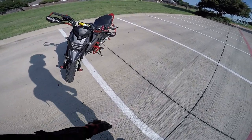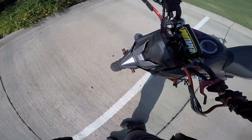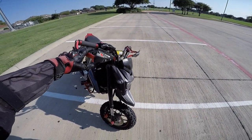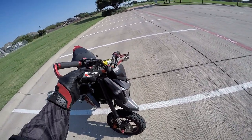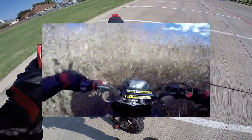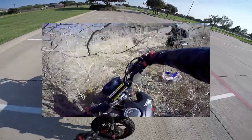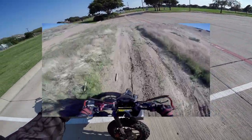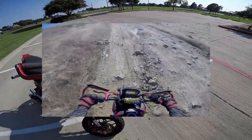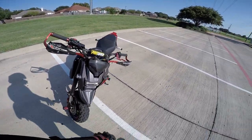Next up are probably the hand guards — these are the Zeta drop-down hand guards. I bought them as a kit on eBay for about $100, but now you have to buy the bars and protectors separately. You can get different styles — I'll link both in the description. They work really well. Before I didn't have hand guards and I messed up my brake lever. These have been lifesavers — whenever you crash off-road it saves your lever so you can still ride, and all the trees and bushes you get into are not a big deal.